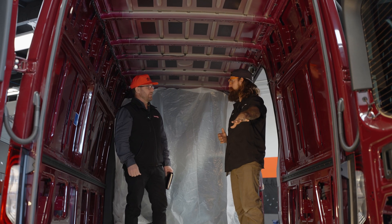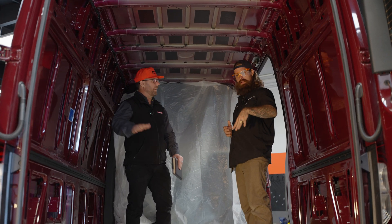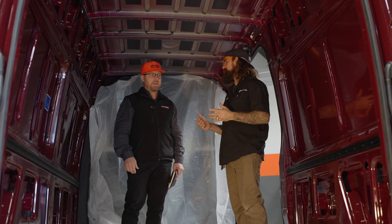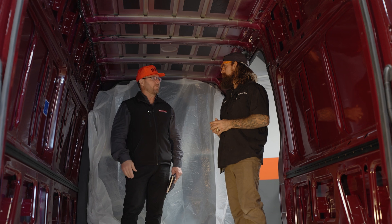We are going to add a new feature that we haven't done before — a 50-amp Anderson plug in our shore power bracket. So then you can plug in flexible solar panels or whatever you want, like portable solar blankets. It'll be right next to where you plug the back of your van in for your AC charge, to supplement the panels on top.